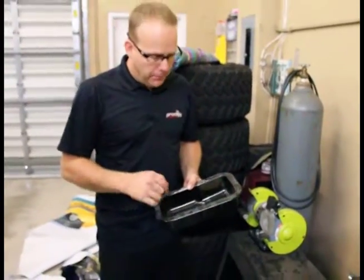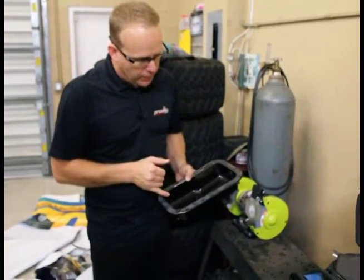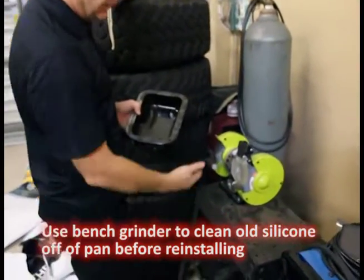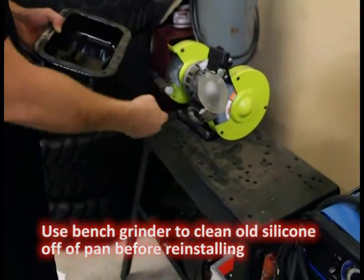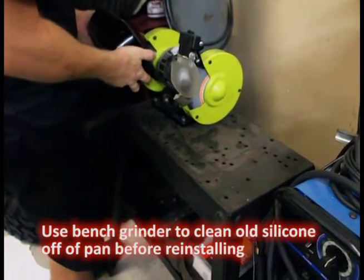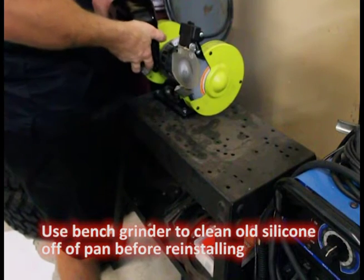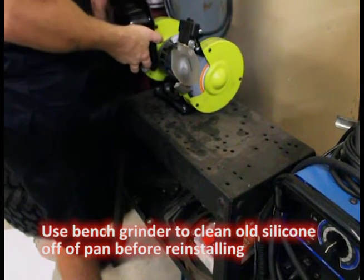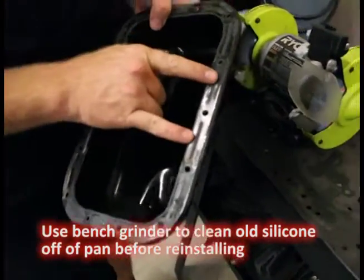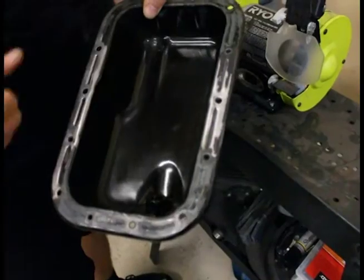So you've got your pan down, but you have all the silicone stuck in the little valley all the way across — it's oozed out, it's a mess. If you try to pick it or scratch with a razor blade, it's very difficult to get off. The easy tool is just a regular bench grinder — a cheap bench grinder, any shop's got one. Just turn it on, wear your safety glasses, and literally in 10 seconds I did 20% of it. I'll continue around and get it off — have a nice clean surface.